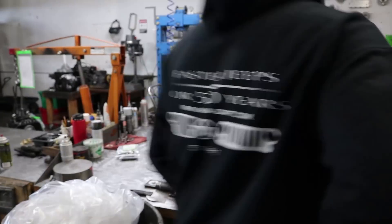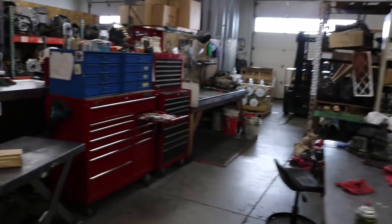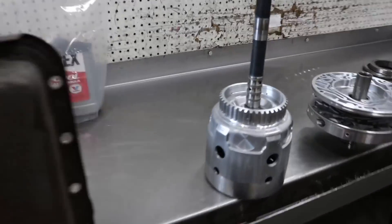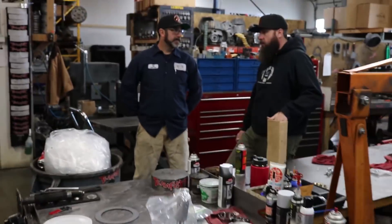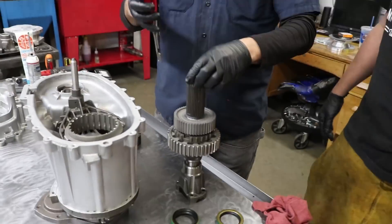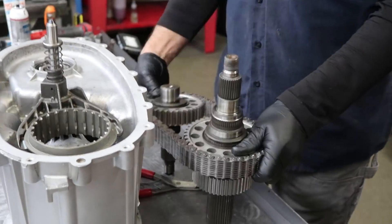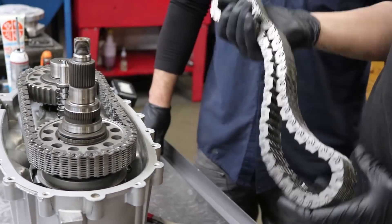I've been asked a couple of times why not go with the Atlas or any other powerhouse-type transfer case, and this is a good time to address that. This is a really thought-out build and it's not a dedicated crawler. It's not going to be trailered to the trails and really ripped on all the time. So when it came time to piece together what we're going to run, it really did make sense to run this configuration — have the power when needed. The other reason you don't need such a low-gear, heavy-duty transfer case is because it's not going to be doing hardcore trail duty rock crawling. With the strength upgrades we did to the 241J and that 4-to-1 first gear, you don't need anything lower than what the 241J offers.